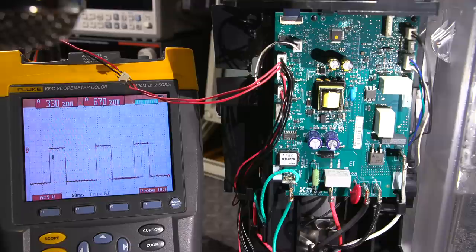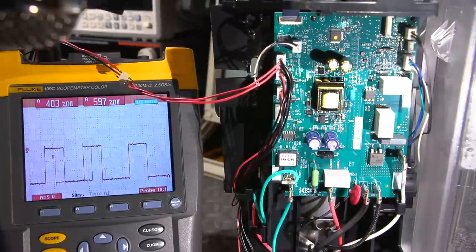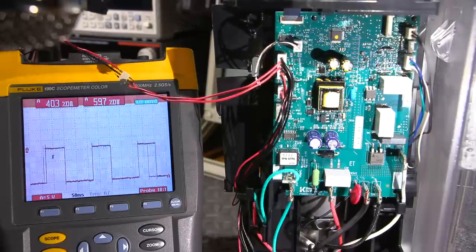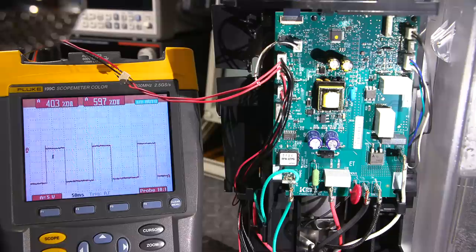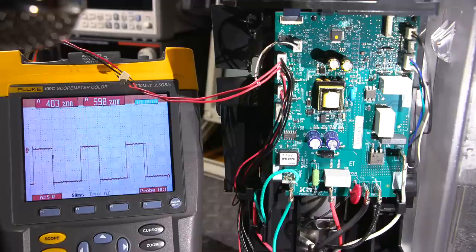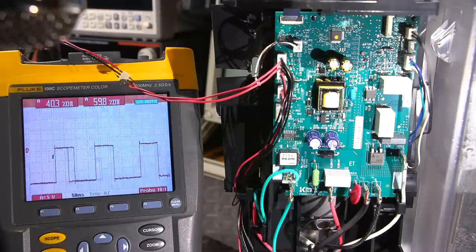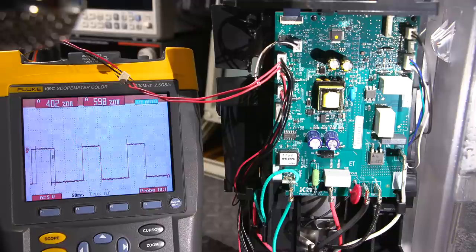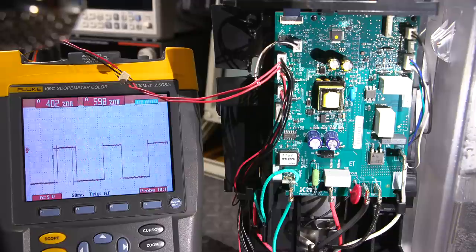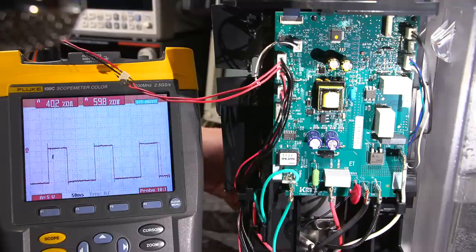Here we go - I'll get ready to produce a coffee, or pump water in this case. That's the speed there. I'm moving the symmetry control on my function generator - as long as it sees pulses it stays running. By adding pulses at 5 Hz and changing the pulse width, I can trick that processor into operating correctly and get my correct cup of coffee back.